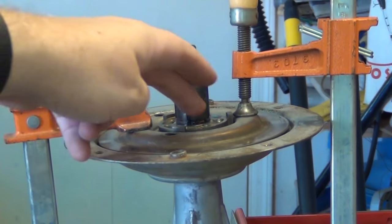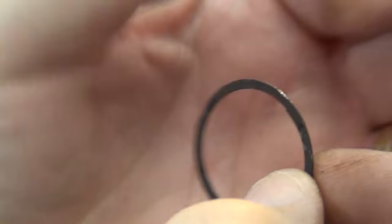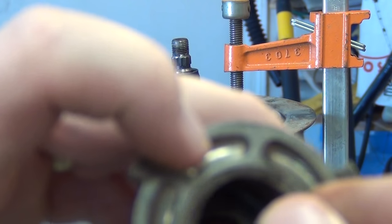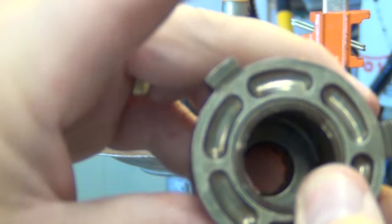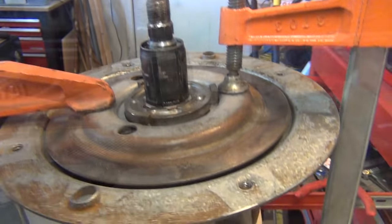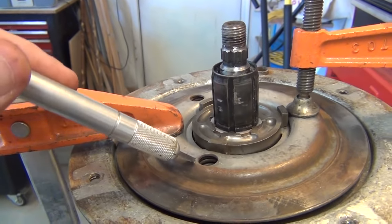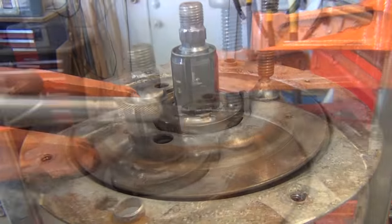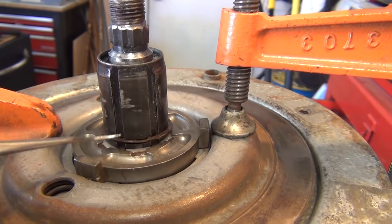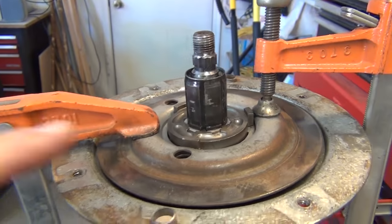You compress it down like that and then you get inside here, scrub and clean with penetrating oil for a while until you can see these rings really clear. Then you just get a little pick like a dental pick and peel them up — there'll be two in there. You can't replace them with regular spring clips because on top of this clutch assembly they have to fit inside there, and a regular one-inch outer spring clip will not replace these. Once you get it compressed on either side, you're compressing these springs, and those springs line up with those holes there. So there's this spiral spring retention clip and once it's in there, that's what holds this assembly from popping up past this point. When those are off, then this all can come up.